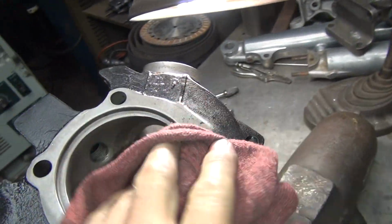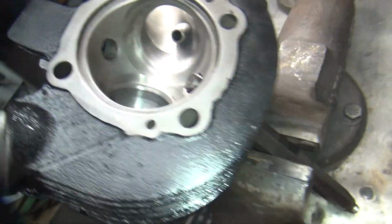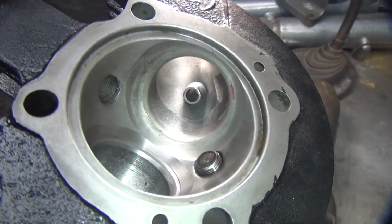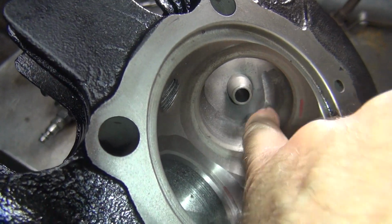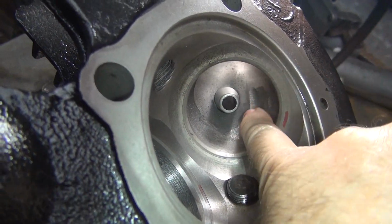Okay, a lot of oil and everything because I lubricated everything. And it's wet for a while. It burns all the oil through the cutter. Alright, so you can see how I'm working that down through here. So this is actually starting to flow pretty good all the way out the port now. We still got the hump on the bottom. But the upper hump there, I kind of blended in a little bit.